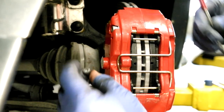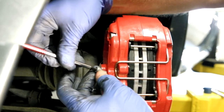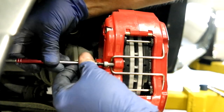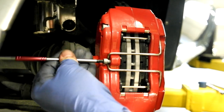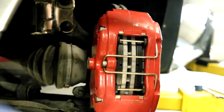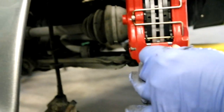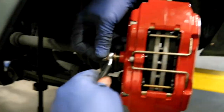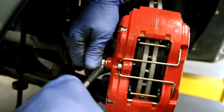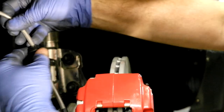For the brake line fitting, you need a 3/16-inch standard Allen key for the locking screw in the back. The 15-degree fitting angle clears the caliper on that side. For the grommet, you can see it's split — turn it around so it goes in and you can just press it into the bracket.